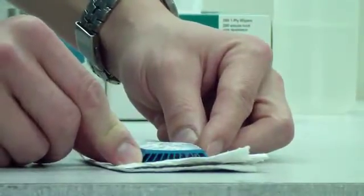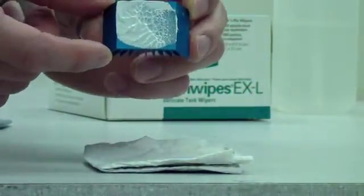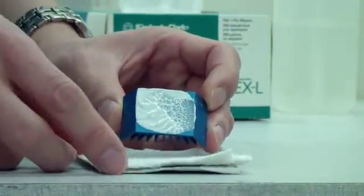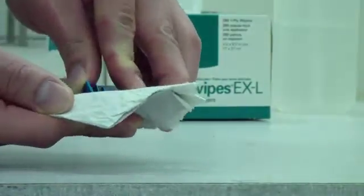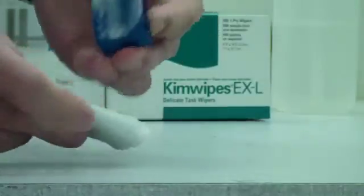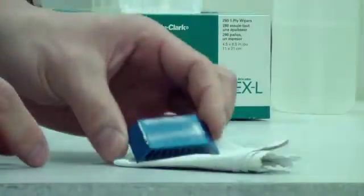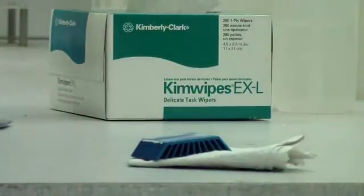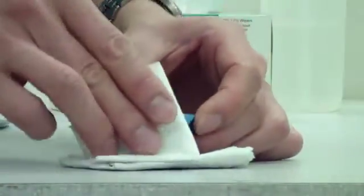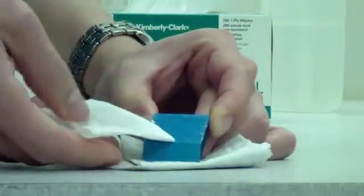Next, we're going to demonstrate the removal of thermal grease from our heat sink. We have a nice little blue heat sink here with thermal grease that has been applied. First we're just going to start by removing as much as we can with a dry towel — you should be able to get the majority of the grease off this way. And then for the leftover residue, we will use a lint-free cloth or rag with some alcohol or some solvent that won't damage your anodization. And with a little bit of elbow grease, we should be able to get the surface pretty clean.